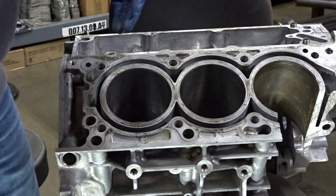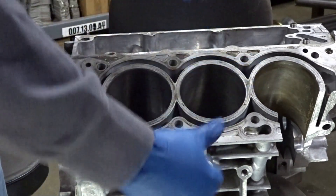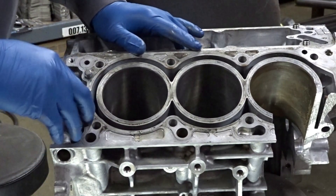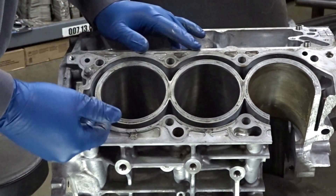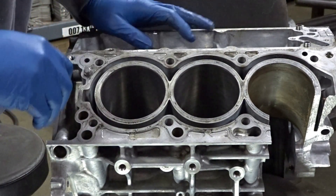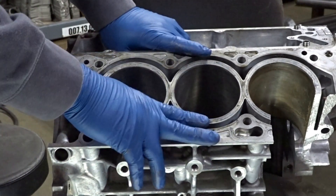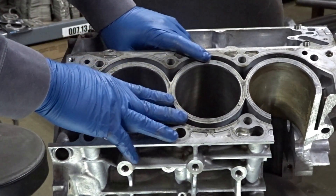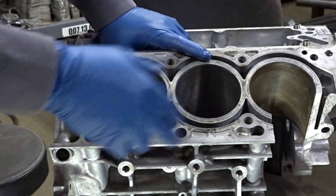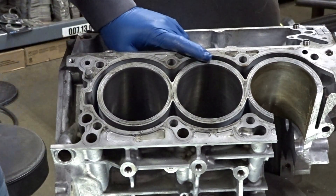Front and rear cylinders normally don't experience as much growth as center cylinders, because center cylinders don't have any additional support — heat-absorbing material, etc. — since there's a lot more aluminum on the ends to dissipate the heat. This bore was shaped almost like an egg. We saw this same thing on the 1.6 on our Veloster platform, and that's why I checked it on the 3.3. Once you start adding more than about 400 to 450 horsepower to the open deck 1.6, we start to see the blocks push apart at the top.